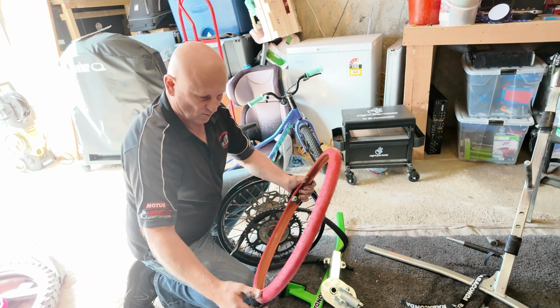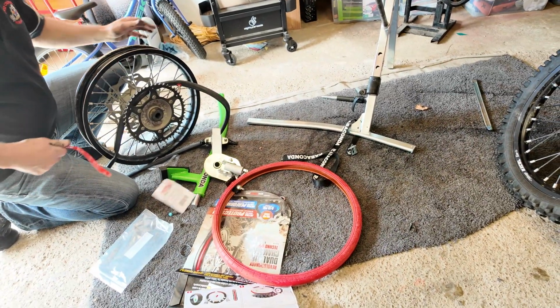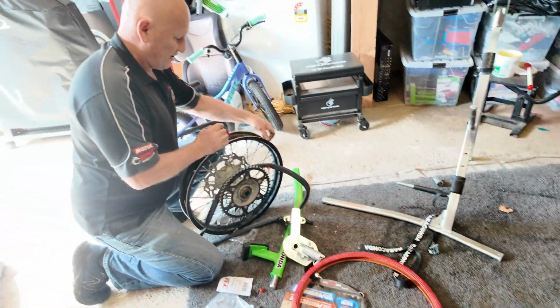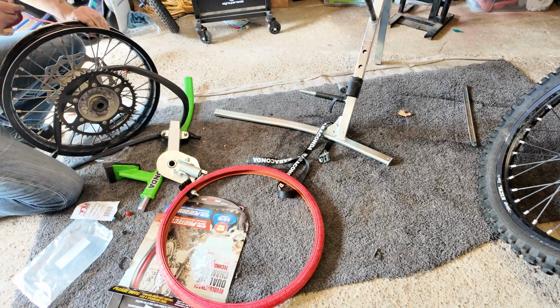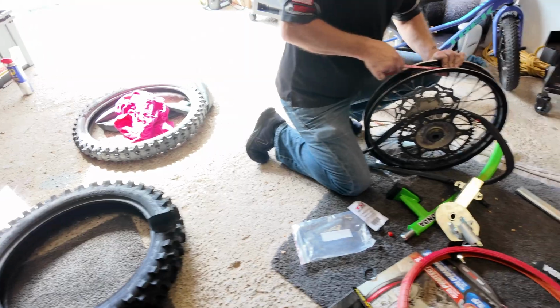This also provides you with rim protection. So if you've got that in the way, you don't run an inner tube. You don't run an inner tube? You run no inner tube. So you just put that in there, inflate that to 100 psi, and then slam the wheel over it. Well, you're slamming the wheel over it before you inflate it.